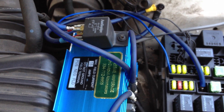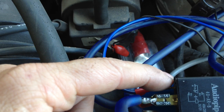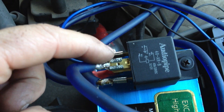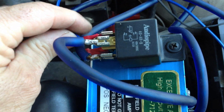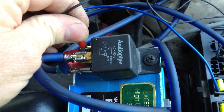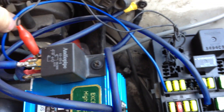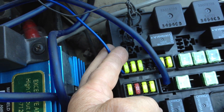The last one we've got on the relay is number 86, which is on the opposite side. You can see the numbers under the relay to show you which wires are going to what. The 86 — you want this to be a switch source, only having power when the switch is on and the vehicle is running. I've got this wire running right here; I've tapped into a fuse that does come on only with the ignition.